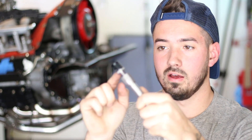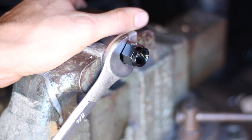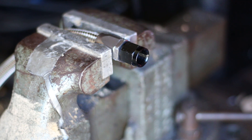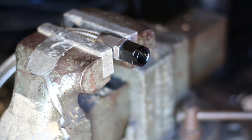...they'll become very difficult to tighten down. We don't have the AN wrenches, so you can just put this part in a vise and use the wrench that's the appropriate size. Once you tighten that all the way down, it expands the hose inside and seals it, and you're good to go. The downside to not using the right tools is that it kind of mars up your nice fitting, but it's functional — and if you watch our channel you know that's all we care about.